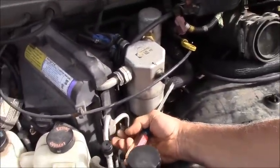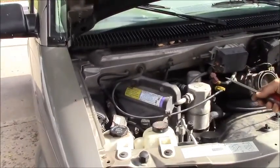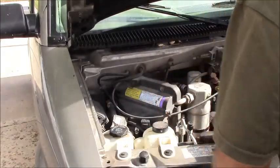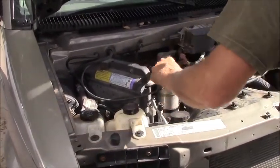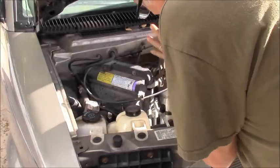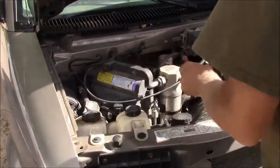There's a little white tapered orifice that lives right in there that we've got to get out. That's not a serviceable joint. This pressure switch is going to have to be replaced. This doesn't turn, but this screws out. That fitting is fixed.